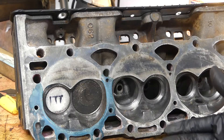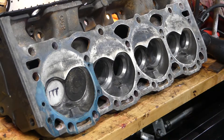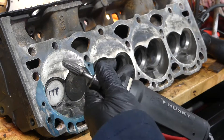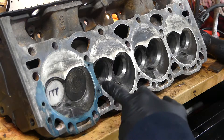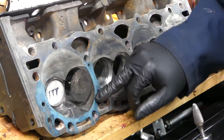You want to try to massage everything so you're getting the best flowing and most efficient port possible. I decided to change the bit — I think this bit is going to work a little better for me, mostly because it's shorter. I'm only going to cut very little, just enough to unshroud the valves so I can continue that swirl effect.